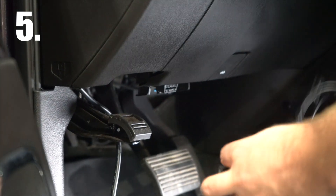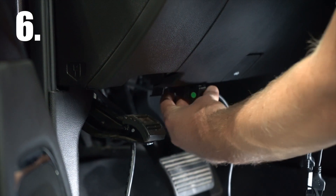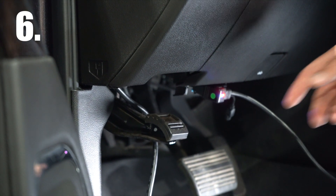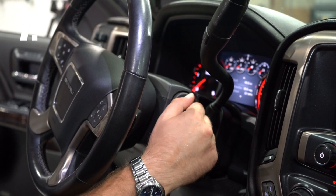Step 5: Plug the auto agent into your OBD-II port using the correct cable. Step 6: If you have a 2018 Plus Cummins, now is the time to plug in your unlock cable. Step 7: Turn the key to the run position — engine not running.